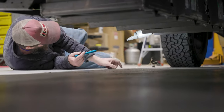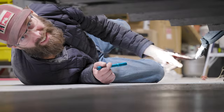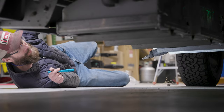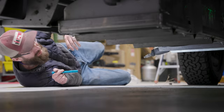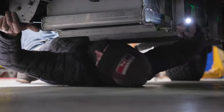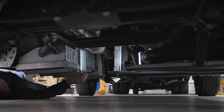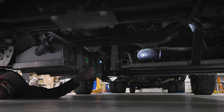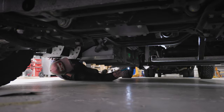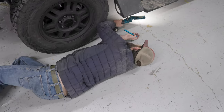Let's take a look at this freshwater drain — just fully dangling right here. Nice freshwater drain, just kind of dangling in the wind. It's like the little kid fountain peeing, and this is right at the curb appeal front of the vehicle. I can't even crawl underneath this — there's not really enough clearance, my belly's hitting on there. The fuel tank is right there. The blackwater tank is underneath the fuel tank — so they've got them stacked. If you want to service the fuel tank or anything, you need to remove the blackwater tank. The Mercedes factory is going to love dealing with that. I just can't believe how little clearance this has, even with a two-inch lift, and they market this as an adventure vehicle.